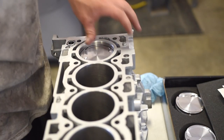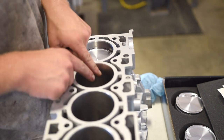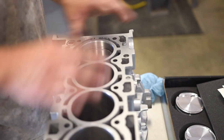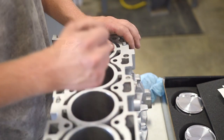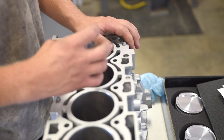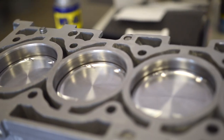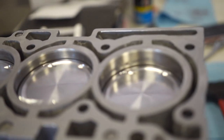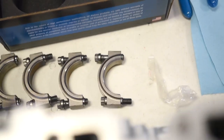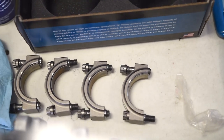Now we can move on to cylinders two, three, and four — all the same process. Clean up the cylinder wall, WD-40 it, slide the piston in. Same process for all four cylinders. All of the pistons are now installed into the cylinders with the rods on them. The caps are off — that's one, two, three, four. Make sure those go back on the rod they came off.